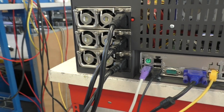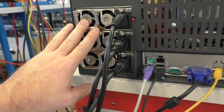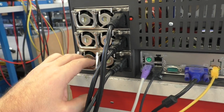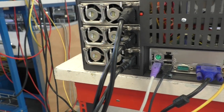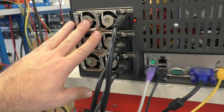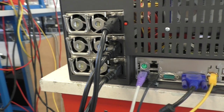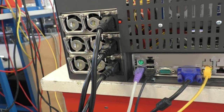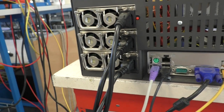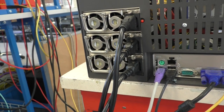We have three redundant power supplies. I personally don't like triple redundant power supplies because my theory is they are so cheap that you need three to have safe operation. Normally, two good power supplies is fine — if you see three, maybe the quality isn't that good. We had servers with three power supplies like this, and every time there was a power outage at least one or two failed. It still works on the third, but that speaks to the quality.